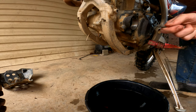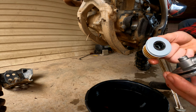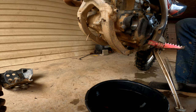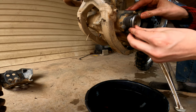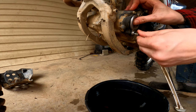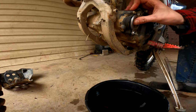Once you have all the oil drained, you'll want to put your oil filter back on. The little cushiony rubber side goes down, and then the spring will go in the back like so, then she'll slide in here just like this. Make sure you put the right bolts in the right spot — obviously put the long bolt in the bottom where it came out from and the short bolt in the top where it came out from.